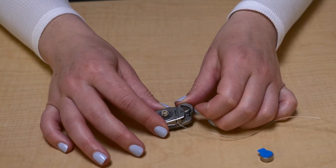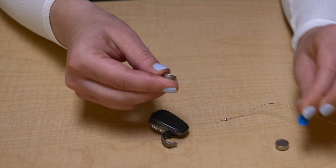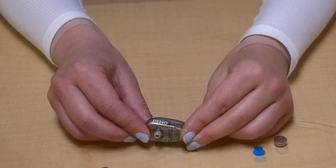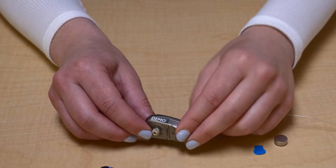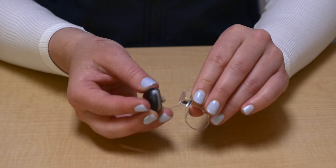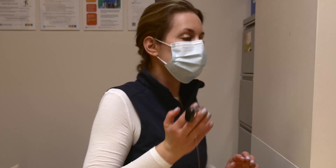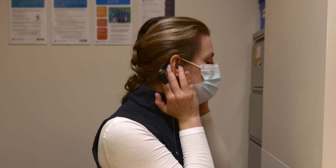Is there no sound coming from the BCSP? Change the battery and make sure to close the battery door completely. Use the listening post to check that the sound sounds okay. Attach the BCSP to the post and hold it behind your ear. You will need to plug your ears and say something in order to test that there is sound coming from the BCSP.